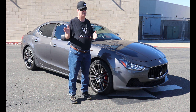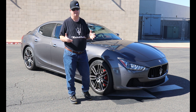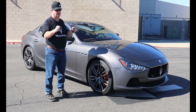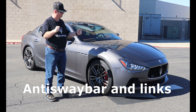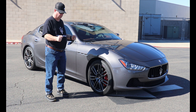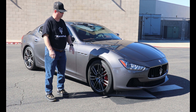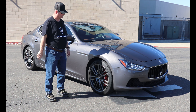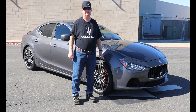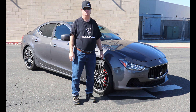Some people have had the lower control arms replaced and it didn't really fix the sound issue — they still make some noise. Mine is nice and solid. I put mine up on my lift and I'm always checking my suspension — I grab onto the controls and shake them, there's no movement, nice and tight. The wheels are nice and tight. I use a crowbar and get in there to move the lower control arms and inspect the rubber bushings — no cracks, they're nice and malleable, no excessive movement, no noise. I have my son turn the steering wheel and I don't hear movement when it's up on the lift.